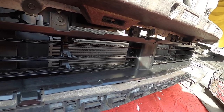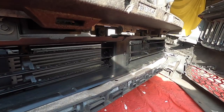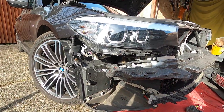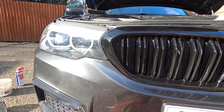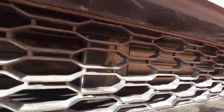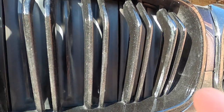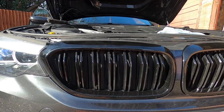Same way it goes back in. Now I'm going to have to put back everything in place - all the bumper, everything back in place. I've connected everything back, started the car, and as you can see the active grille is now closed, and the bottom one as well - everything works fine. The top and the little motor had been replaced already and it was still not working, so now I've replaced the lower part, the other active grille, and it's working now.